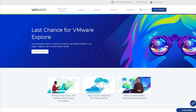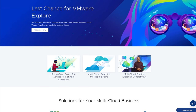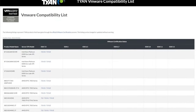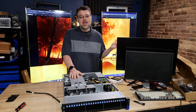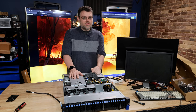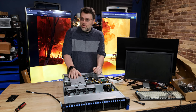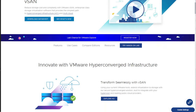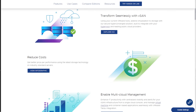If you're thinking about VMware, you're a VMware shop, you do ReFS, Hyper-V clusters, it's going to be mixed workload environments. Again, if you're building a cluster of these and you don't need extreme density, you get four of these 2U rack servers, just 8U of rack space. You have tons of storage. And even though an argument could be made for a dual socket configuration for a VM host mixed workload, 64 cores in a single socket with the same 6 TB memory capacity, for most things, that's the sweet spot of density versus capacity versus performance.